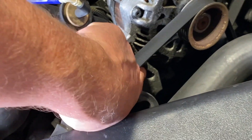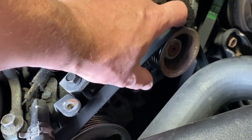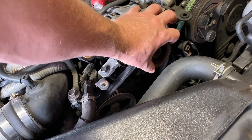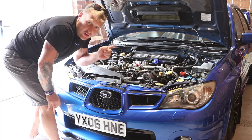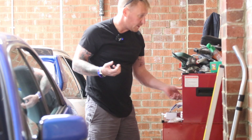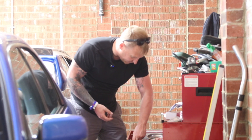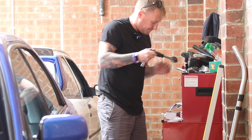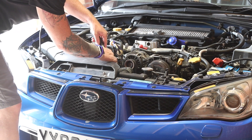Then you adjust this and it will move the alternator to put tension on the belt — moving it up takes up the slack. That makes sense. All I need before now is a 12mm socket and maybe a little extension — there we go, 12mm socket and ratchet. So we're just going to slacken this.